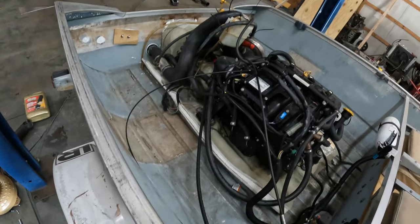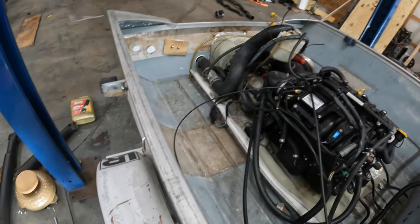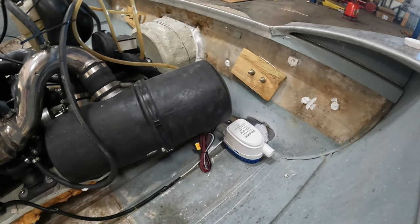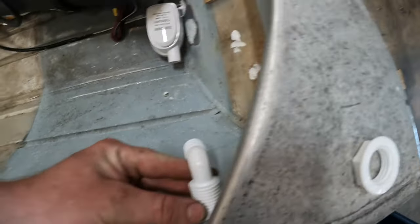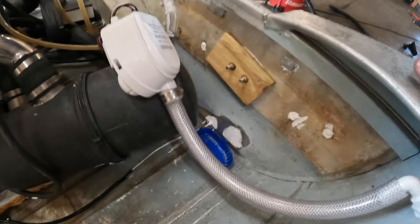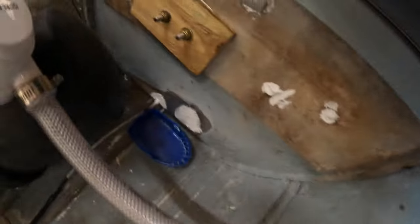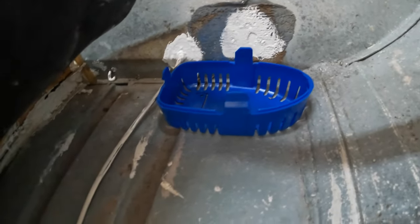I've got a bilge pump to go on either side of the jet ski hull, and a drain plug on either side also, because water won't drain from just one side — it won't go across the hull. Got the bilge pump sitting kind of where it's going to go. I don't have any hose for it yet, but I had that fitting — it's just a 90-degree fitting. I'm going to tuck it right up in there so I can have a piece of hose tucked right up against the side of the boat. I just got to drill a one-inch hole right in there. I got one of the bilge pumps routed on here; these have a one-inch outlet so I had to stretch the hose for my three-quarter inch through-hole fitting. I'm going to glue the bottom of it to the floor of the boat because I don't want to put screws through the boat to hold it in. It worked on the other boat, so it should work on this one.